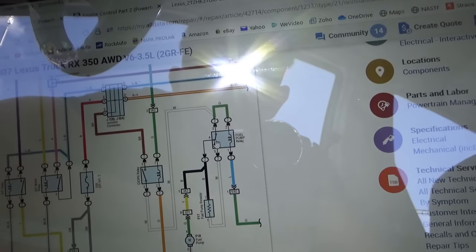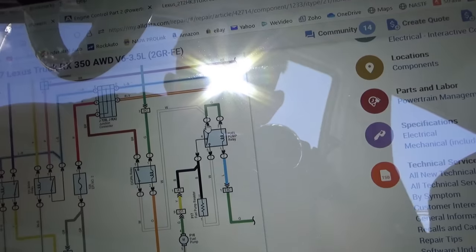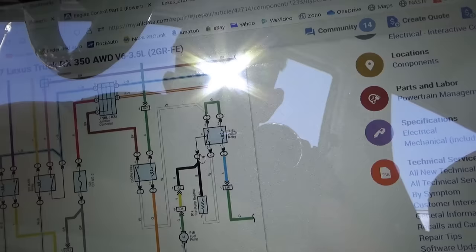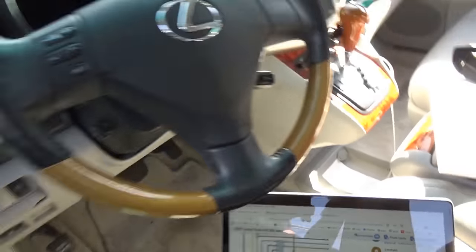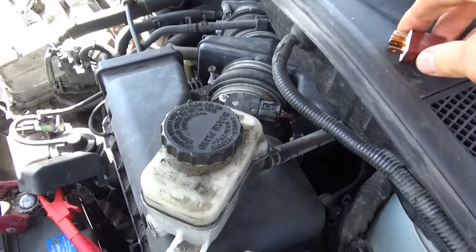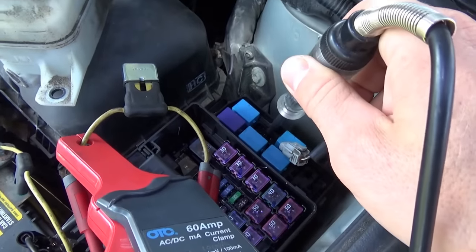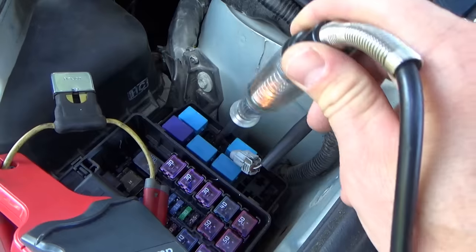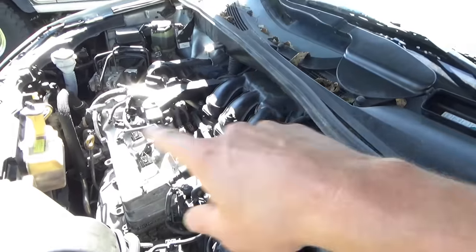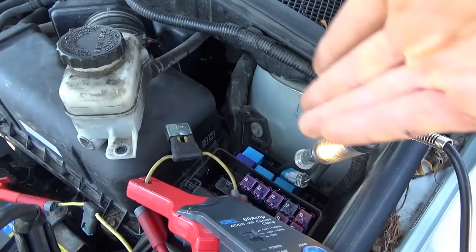The copper colored one, and then the other two fat ones, I guess 3 and 5, one would be the power feed and 5 would be going through the fuel pump resistor. Again, we can easily check that by leaving the test light in here from battery positive. So for example, that's lit up, that's not lit up. When we plug in the resistor, that should continue, or connect the path through the fuel pump, and our test light should change on one of those pins.